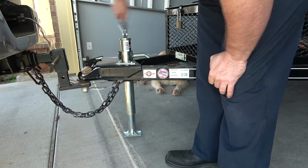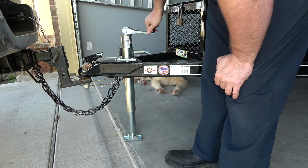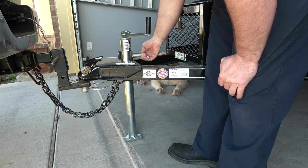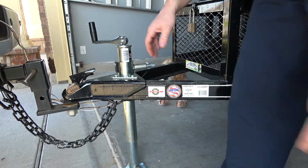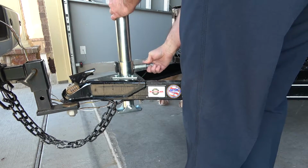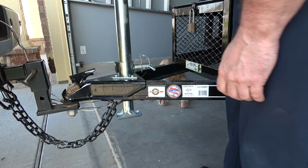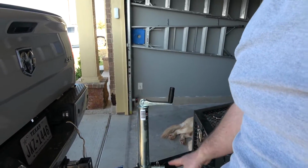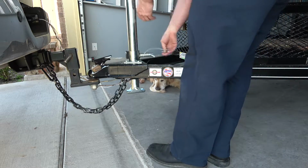And so here you see the classic, what most people have to do with their jacks that are fixed is tons and tons of rotation on that. Whereas here, get it set right about where you need it. That jack is all the way in the lowered position. Rotate the handle up, as you see here. And now I'm showing you that bevel there, which pulls, that's a spring-loaded shaft there, so it pulls that out of the locking pin. Now you can slide it up, and you've got several different positions throughout the jack, about every 3 or 4 inches that you can lock it back into. Lock the jack back in there, and now you're ready to go. Off the ground in seconds. So it's literally only a couple turns to get that thing from full deployment to full retraction. And you can make adjustments however you need to keep it from hitting your tailgate if you needed to lower the main part of the jack a little bit and you wanted to sacrifice some of the spin.